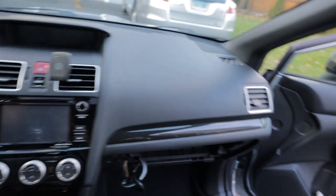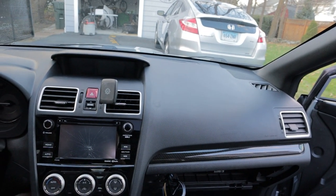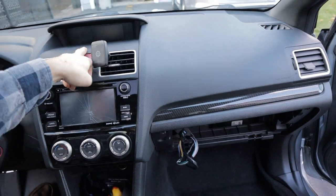I'm glad this upgrade came at a really opportune time. The glove box is already removed. Next is just a 10 millimeter bolt in the back here behind the steering column, and then another one back there, and then I'm going to pop this out.